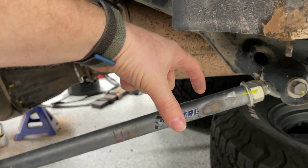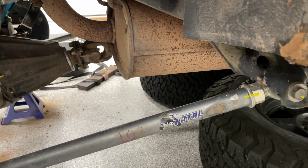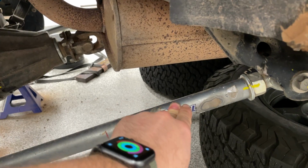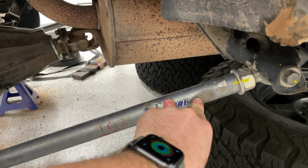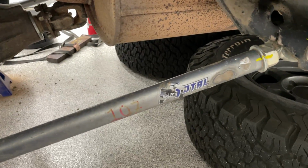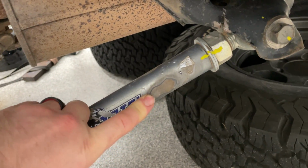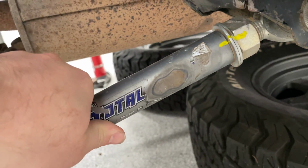So the truck has axle wrap. Because of the panhard in the back, it'll swing one way to the other, which means this control arm could probably be very close to touching, if not touching, the wheel at flex once this thing failed and pushed out more to the side. The reason why I say that this was an organic material like that rubbed that, is because it's relatively smooth, and I have an example of something else doing the same.